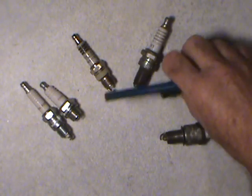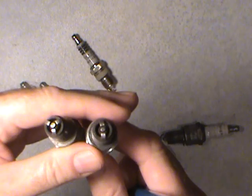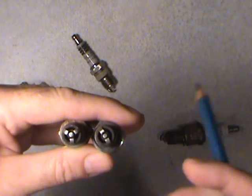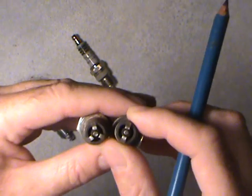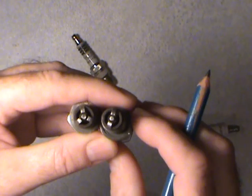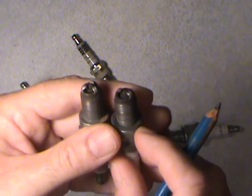In another example that I have here, these two are actually different ones out of a Mazda rotary engine — probably in the mid-70s they came up with this kind of plug. There's no valves in that kind of an engine. There's two rotors and four spark plugs, two spark plugs per rotor. These are two different styles. You'll notice here there's a dual outer ground strap and the center electrode in the middle. And on this one, it's got three side electrodes. I guess they found that you get better spark coverage perhaps. That's what was in the rotary engine of the day.